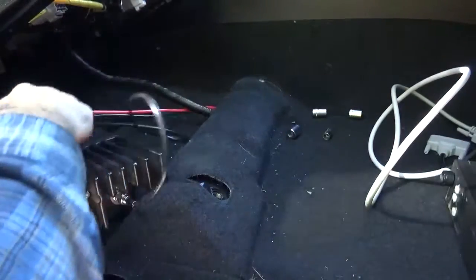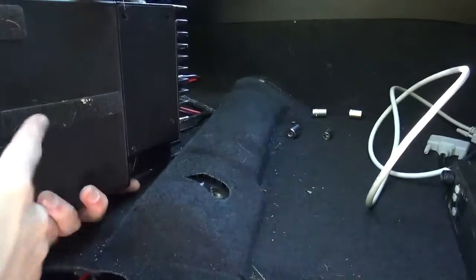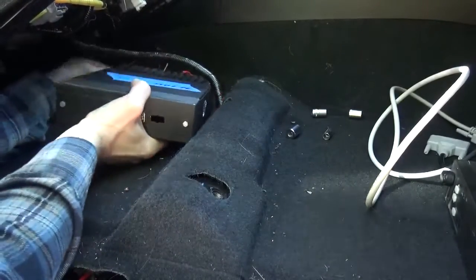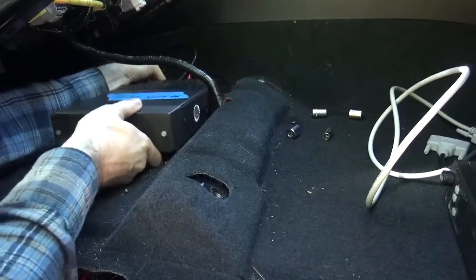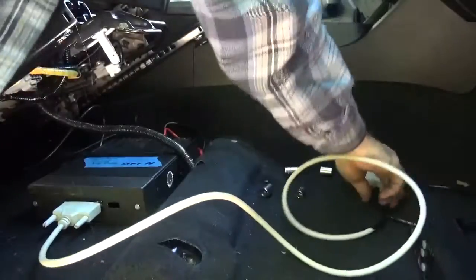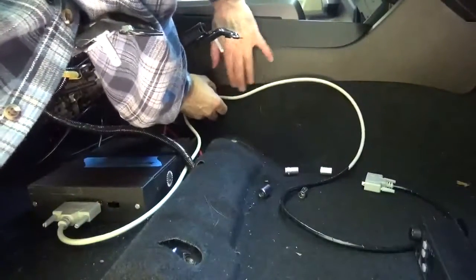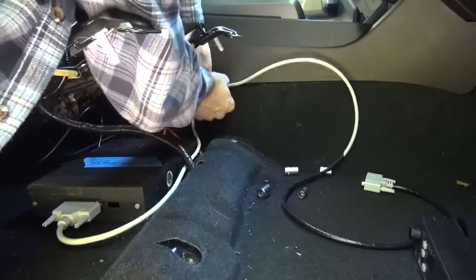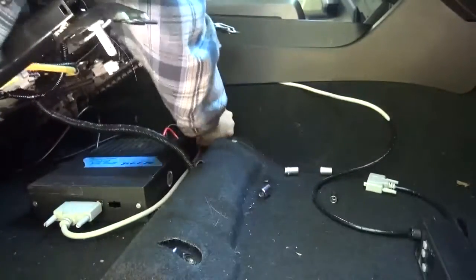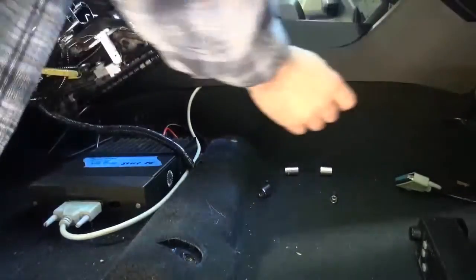We're going to plug the power into the radio. This is the hard part of Velcro — the stiff part. We're going to lay this on the carpet, which grabs really, really well. If there are any floor vents like there is in this vehicle, make sure the radio isn't covering them. I'm going to place that right about there — and that's not going anywhere. Running it right along here and up underneath this edge of the center console, right along the edge. That's something you're not going to see — the seat will be covering that.